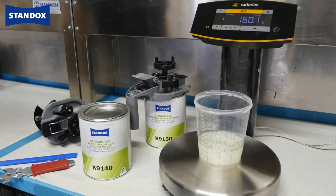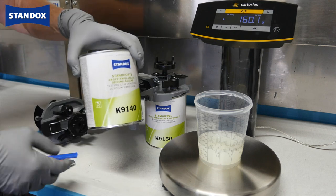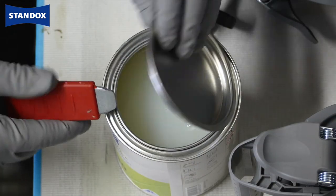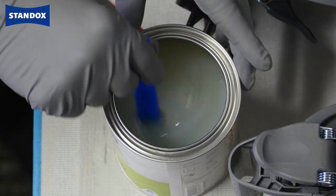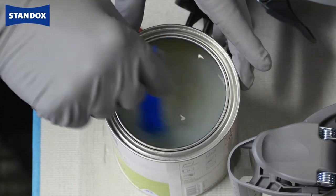When it comes to preparing the clear coat ready for use it is simply a repeat of the correct combination of the two clears that you identified when you made your spray out cards. Stir the material thoroughly before each and every use — it's worth noting that we have left room for you to stir by deliberately under-filling the can so you do not lose material over the top or sides during stirring.